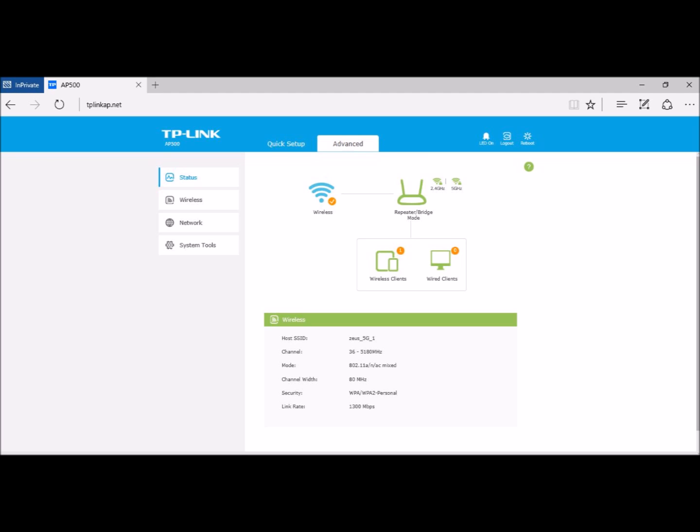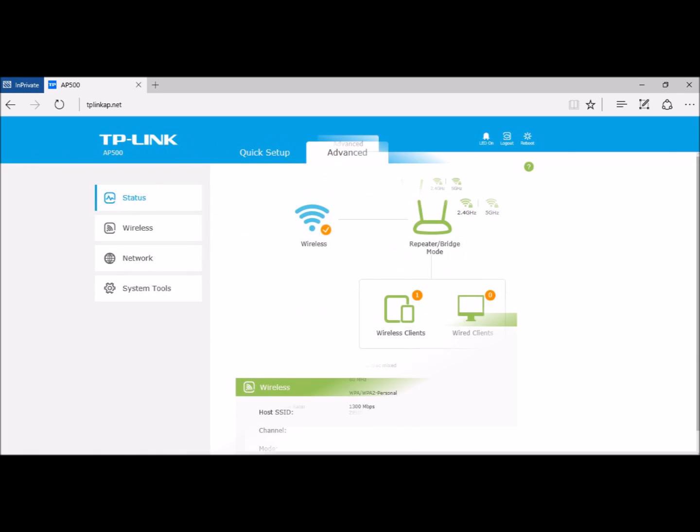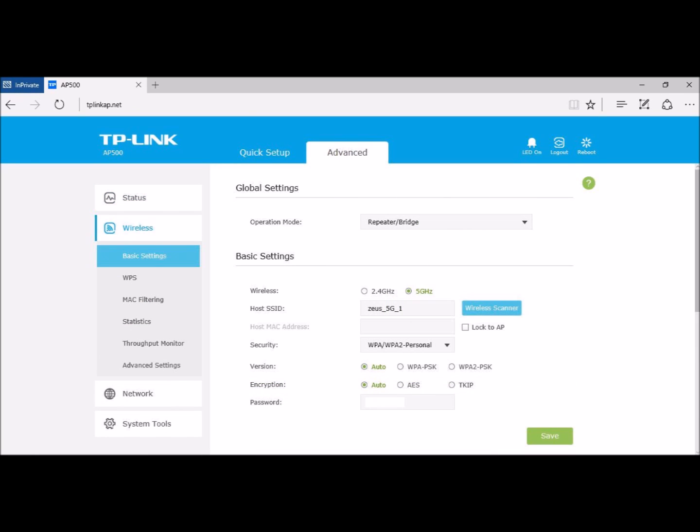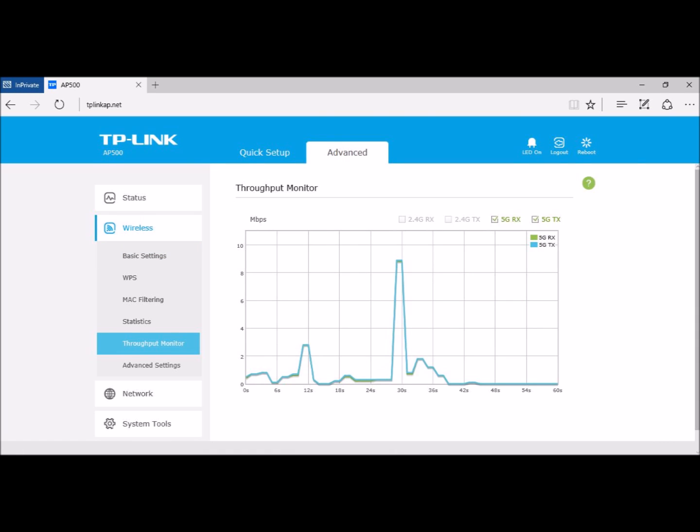On the Wi-Fi Analyzer tool and Wi-Fi Commander graphs, all the networks now appeared, including the new AP500 SSIDs, Aries and Aries 5G. My router is configured to use channel 9 at 2.4 GHz. I know it's theoretically desirable to use channel 1, 6, or 11 in order to avoid overlap. However, in my home, empirically, I've always gotten the fastest speed tests with channel 9, regardless of the router. The AP500 automatically selects either channel 1, 6, or 11 on the 2.4 GHz band, never 9.